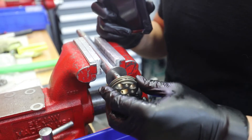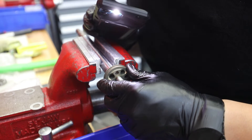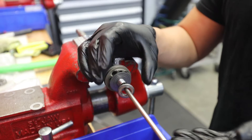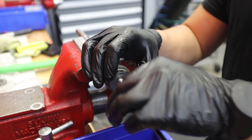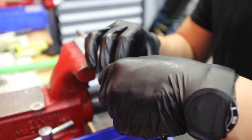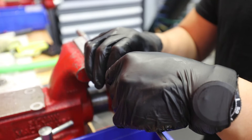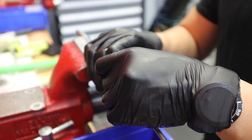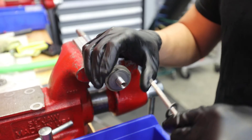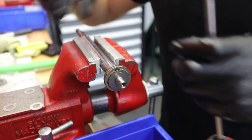I'm just going to take my little flashlight and slide this on and look through the hole on the top to make sure that it lines up — and it lines up. I'm using the old shims because this damper was already valved for the specific car that it's going onto, and I don't want to change the shims because that will change how it's valved. Nothing wrong with these shims at all. If there's one that was bent, I would replace that shim — you just measure it with a caliper for diameter and thickness.